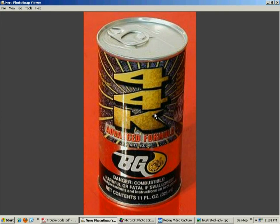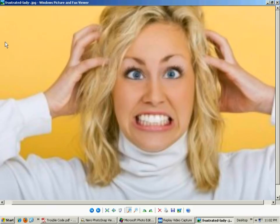For both the P0141 and P0420 codes, it's worth trying Seafoam or — personally I like — BG 44K. These things work so well that even if you had a fuel filter that probably needed to be changed, using this type of stuff could keep that filter from clogging. It's so powerful that it actually cleans the dirt out of the fuel filter. I'm just putting this out as a cost-saving tip so people don't go nuts with extra bills.